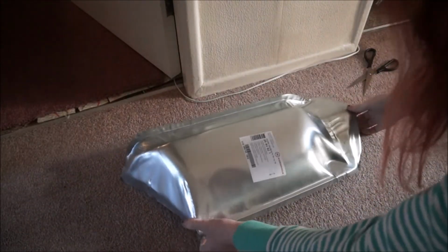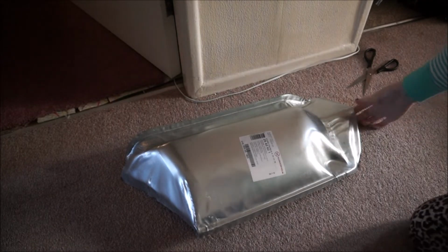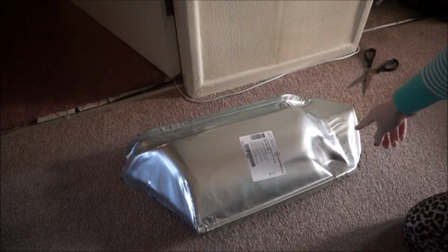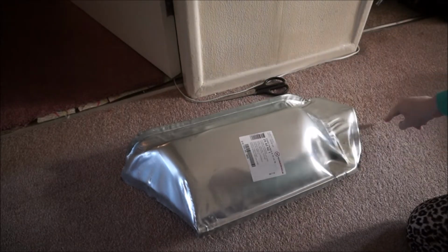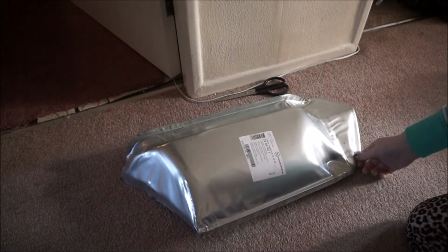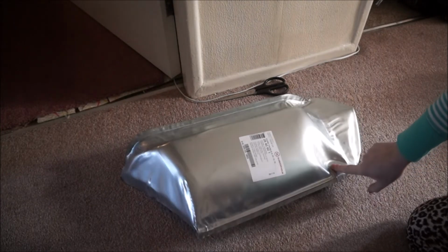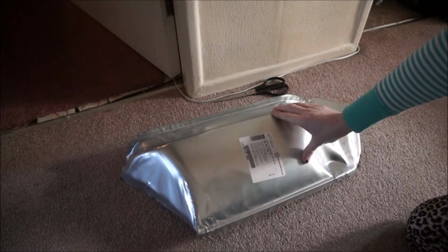Okay, so this is the inner rear quarter for the Cortina on the passenger side, but these are extended for the Estate model. There's a piece that comes out the end here. You see that? So it comes out the end there and it's just extended, just a plate welded onto it. I've looked at pictures of one that was welded into the Mark III, but this is for a Mark IV slash Mark V.